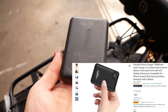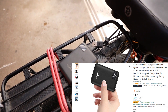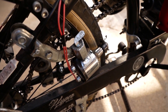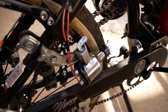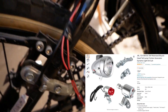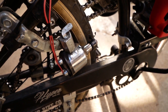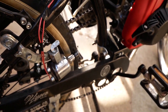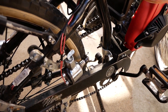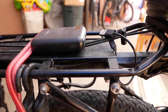It's a 10,000 milliamp power bank and it works fairly well. I think I could go about four or five night rides without having to charge it, each ride being about one hour. Recharging the power bank was something I thought about, and I decided on using a bottle dynamo. This dynamo is definitely not efficient — it has a lot of friction loss — but it does charge. It's best viewed as a backup passive recharge. It took about six minutes of continuous riding to get maybe one or two percent onto the power bank.